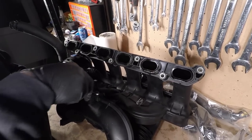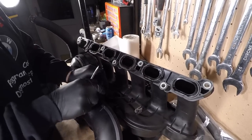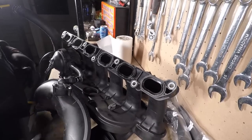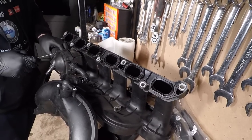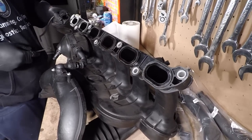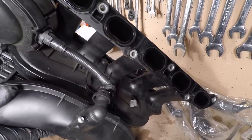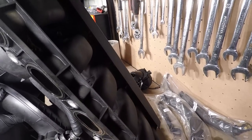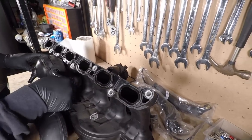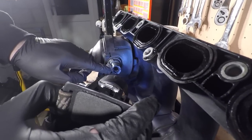The CCV is now on the bench. We're going to crack off all the clips from the PCV heater — we don't need to be careful since the whole thing's being replaced. To get the new one on, the seals will be tight, so I suggest using vaseline or lubricant — whatever you choose. Also I advise assembling everything on the bench rather than back on the car. Now we've taken the hose off — as you can see there's the problem: it was cracked. I don't know if you can see into the hole, but that's how clogged the CCV is.